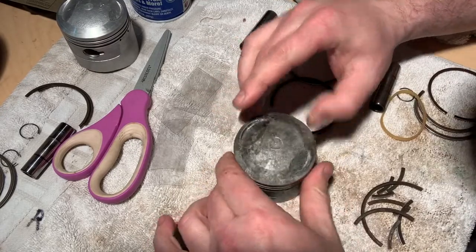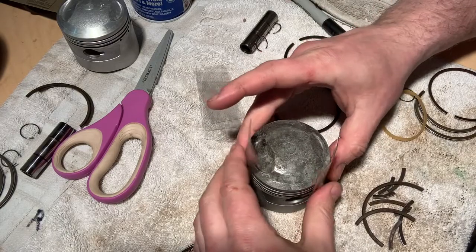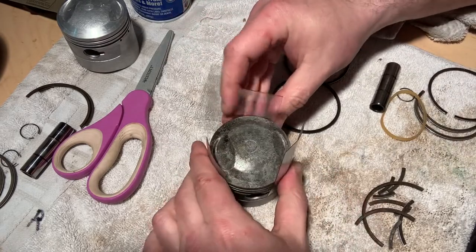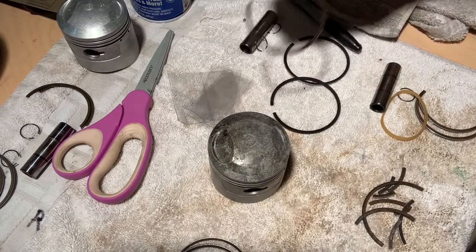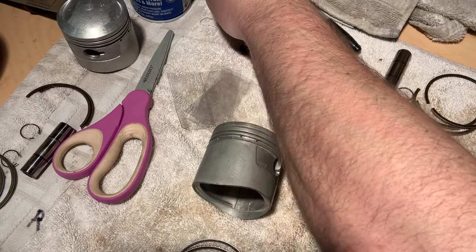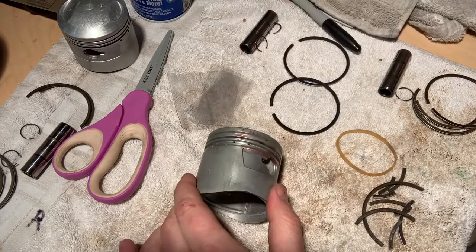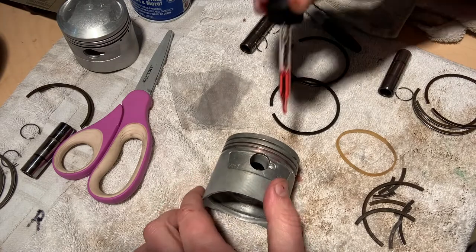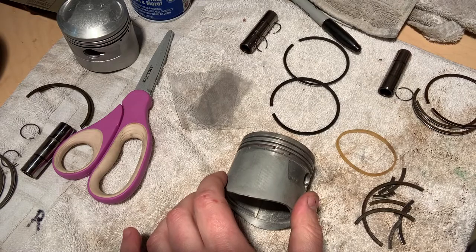We got that all blown out. One thing I want to try today - I was watching some videos on tips to install these things, and somebody used a few little plastic guides, some kind of thin plastic. I'll link to the video. It made a lot of sense for getting these things slipped on, because I think what really kills you is if you too aggressively pull on these they're going to break, as we noticed yesterday. I want to rig that up, but first I really want to get this thing lubed up. I'm going to use Marvel Mystery Oil and really lubricate up this section of the piston so I have a little bit of an assist when I get these rings going.